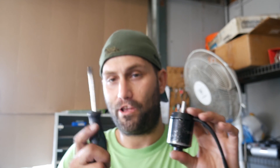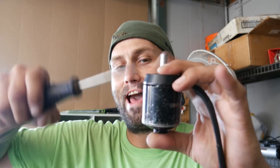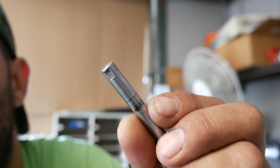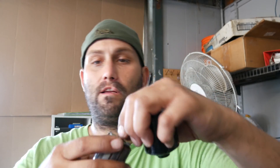If you wanna crack this open carefully without damaging anything, you can use a screwdriver — but be super careful, because you're gonna have wires in here you don't wanna hit. Put your screwdriver in just a tiny bit and turn it to create the gap. Do it on one side, then go on the other side. You can also lightly tap the shaft end. I wouldn't put this in a vise — I wouldn't wanna mess up the outer covering. Once it's tapped out, look at the back side of the shaft — you'll see the recessed spot. Make sure those set screws are backed out enough or you'll never get the shaft out. On the bottom is that brass sleeve — don't lose that, you're gonna need it when you put the motor back together.